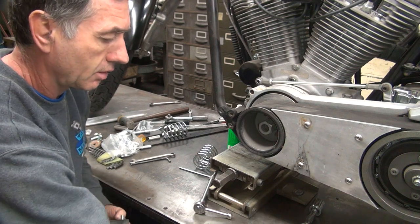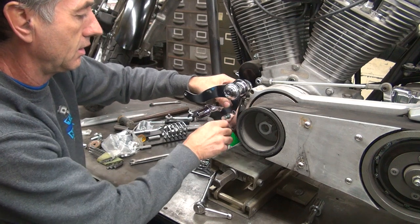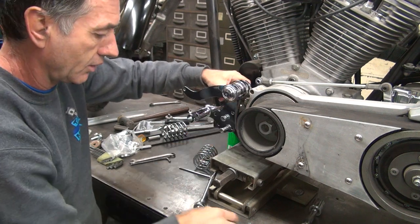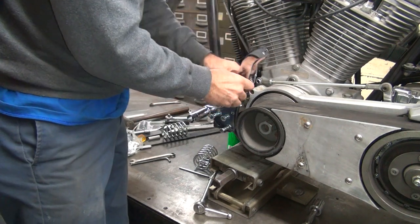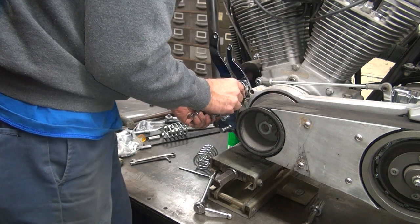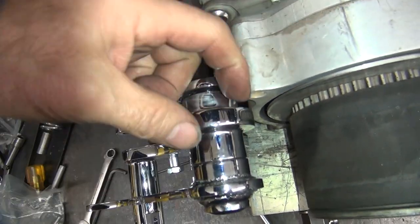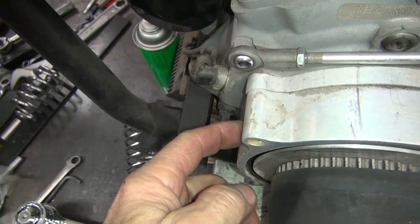Okay, there are the big bolts. These are the small bolts. Looks like we're still having some interference issues here. Yep, we are hitting on the inner piece. It's not as bad as the front piece, but it is hitting. So this piece here sticks way back, this one only sticks a little bit, but it doesn't matter — it's hitting. So this here needs to come off a little bit right in this area. I got to mark it so I know where it needs to be cut.